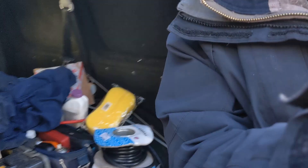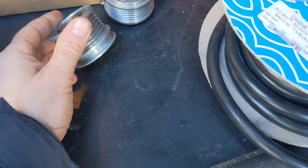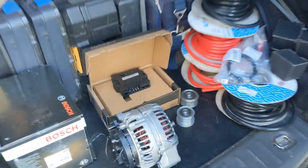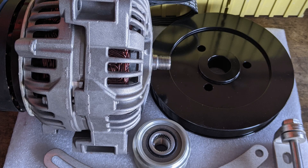I'm also fitting freewheeling pulleys. There are a few options with this setup — it's already got a really big crank pulley so I'm not entirely sure which one I'll fit yet. There are also different offsets, so I keep loads of different pulleys in stock so there's no messing about on the job. On this exact setup — a 200 amp Bosch alternator with a Wakespeed or Alpha Pro controller — I've done these setups for Isuzu engines with a 6PK poly V conversion, and also some Barrus engines that only had a V belt but can get a 6PK conversion too.